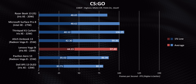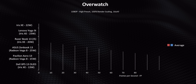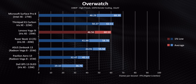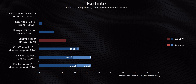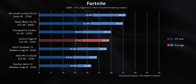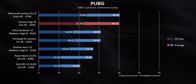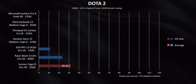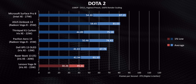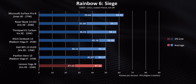Intel does gain a pretty big advantage anywhere integrated graphics can be used — Premiere is a perfect example. However, moving into gaming, there are some interesting issues. For whatever reason, Lenovo is capping the Iris Xe integrated graphics at just 9 watts, while almost every other laptop here runs their IGP between 12 and 15 watts — and that makes a massive difference. Instead of leading, the 9i's frame rates are all over the place. This kind of inconsistency is the last thing I want from Intel's newest architecture in an otherwise amazing little laptop.